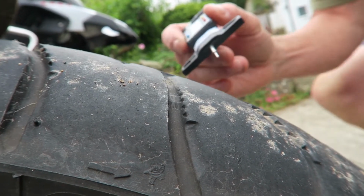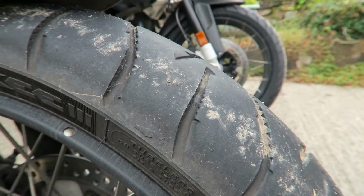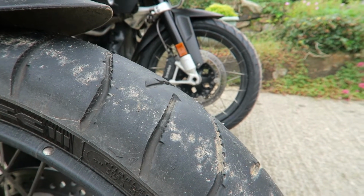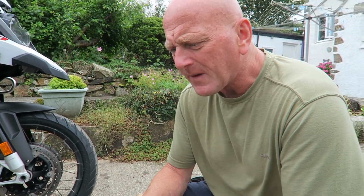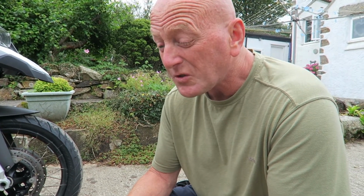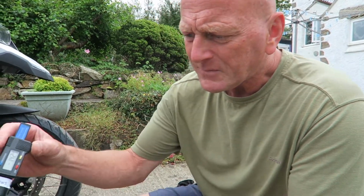Use that as a guide, a visual guide, when you're just about to get on the bike, just to double check, because the tyre tread goes down at an alarming rate really. If you don't check it, it's something you take for granted, isn't it? Well, I found, particularly on these tyres, and again it's just my opinion, that when I changed the tyres over, I was getting down to just under 2 mil on the tread, and I found there was a marked difference in how the bike rode then. So it was enough for me to want to change them straight away. So, measuring.